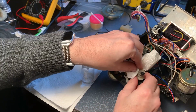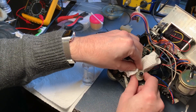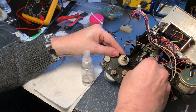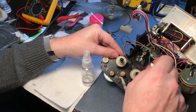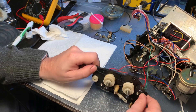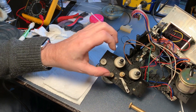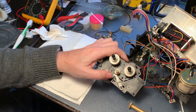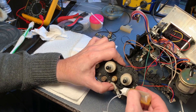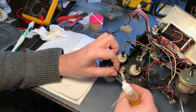What I'm doing here is cleaning the pickup reels with some alcohol. I just want to make sure that the idler tire has some really good grip later when we put it all back together. Just a tiny drop of oil makes sure that every lever moves smoothly.